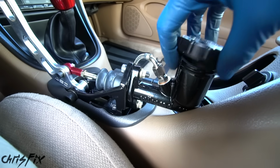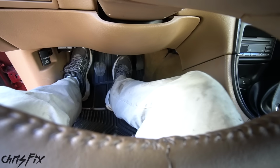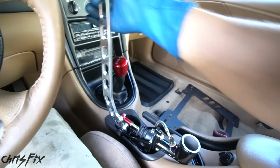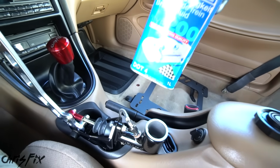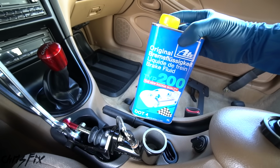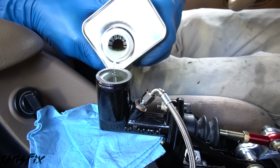And bleeding a hydraulic e-brake is very similar to bleeding the brakes on your car, where you pump the brakes with your foot, but instead of with your foot, you're pulling this lever and pumping them with your arm. So the first thing we want to do is get DOT 4 or DOT 3 brake fluid. This was sent in by a subscriber, which is awesome, contributing to the build, and we're gonna want to fill this reservoir up to the top.